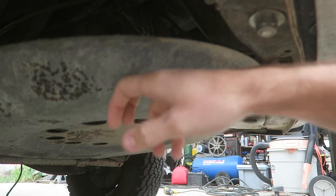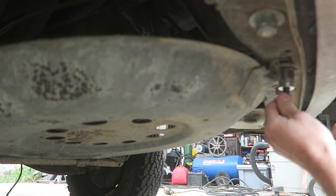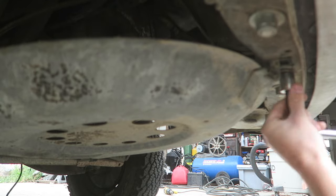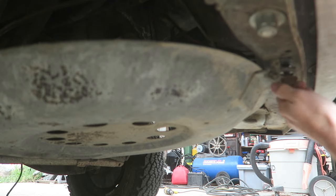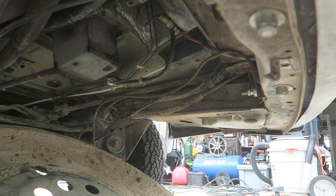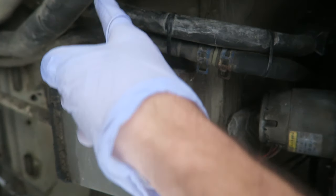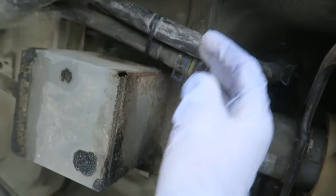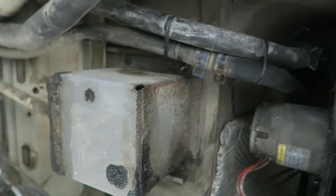Underneath the van now — this is where your spare tire usually goes. I don't have a spare tire in there right now, but that's where it goes. You got to go ahead and get a 19mm and loosen it up, take it all the way off actually. There's a little pin, a little dude you got to pull back. But there's the shifting box right there. I just had to bust two zip ties out of the way. It looks like it has four 10mm bolts or nuts holding it in, so I'm going to go ahead and loosen those up and hopefully this box will just drop right down.